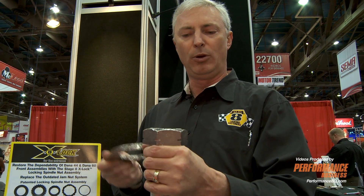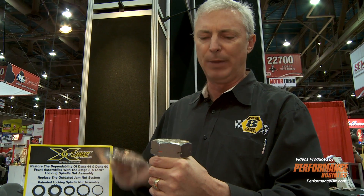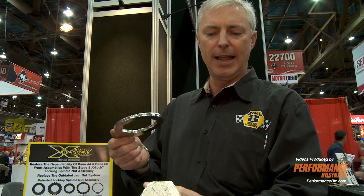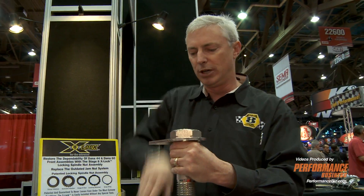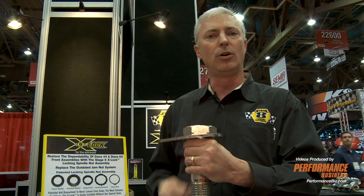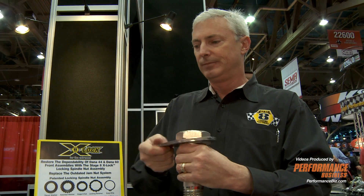It actually goes on a suspension bridge made by the Army Corps of Engineers. Same thing — you put the bolt in and this gets torqued to about 350 foot-pounds. It's a grade 8 bolt. The retainer goes over it, right against an abutment on the bridge, and the snap ring goes over to hold it down. It cannot come loose because they're mechanically locked.